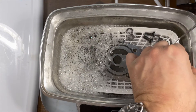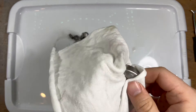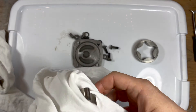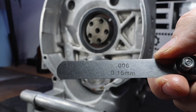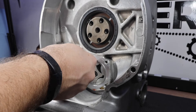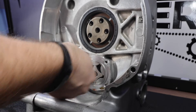With the ultrasonic cleaning done I can already see they're much much cleaner than they were. The outer race of this oil pump is definitely scuffed — there's been some metal in there in the past, you can see some scraping — but I think it's in good enough condition to reuse. I've put the parts in dry before lubing them just to check the clearance, to make sure I don't need to replace this pump. From checking on forums, the consensus seems to be that it's good to go.